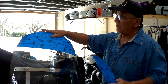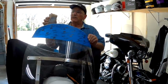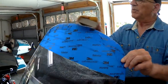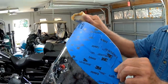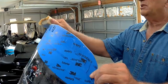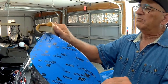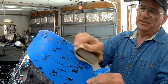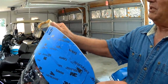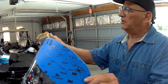I'm using 200 grit right now with the sanding block and I've got it pretty good — you can feel where there are little bumps where the jigsaw blade wasn't perfect. Next I'll go down to probably about 1500, and maybe even 2000 grit. If I go down to 2000 it should be just as smooth as a factory edge. So far so good.